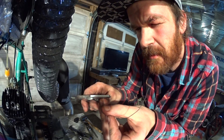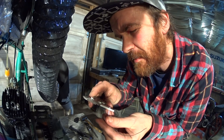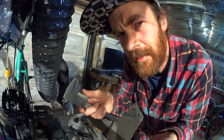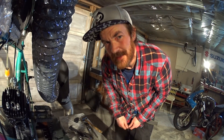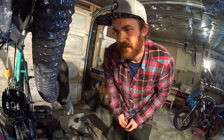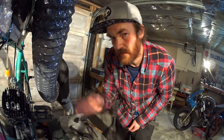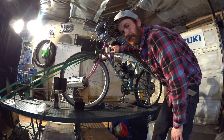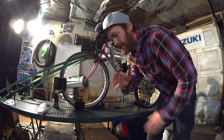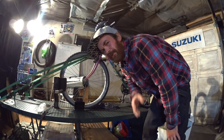I think we've gone a bit overboard. We're measuring a squish gap of 0.5 millimeters. In any other normal engine I would say that's pretty much safe for a 38 millimeter stroke in this one — not quite sure, but we'll try it. I'm going to put back the exhaust end cap, because this took much longer than I expected and it's late at night and I don't want to wake up my girlfriend.